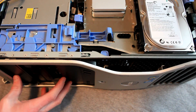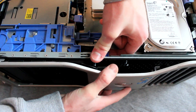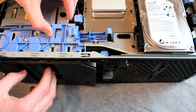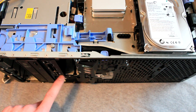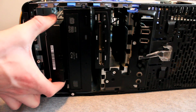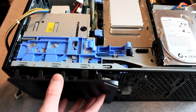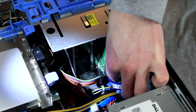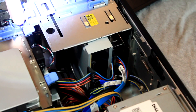We will need to remove the front panel and the drive bay cover to access the bays. To remove the front panel, pull up on the blue tab inside the front of the computer and then push the silver front panel up to remove it. To remove the plastic drive bay cover, push down on the blue plastic latch and pull the cover away from the computer. We now have access to both 5.25 inch drive bays as well as the one 3.5 inch bay at the front of the computer. It is simply a matter of lining the hard drive up with the bay, gently sliding it into the computer and latching the drive into place. Then we will replace the drive bay cover and the front panel on the computer. Now we will make the SATA connection and connect the power at the back of the hard drive. The DVD drive has been slid out of the way to make it easier to see this process, but it is not necessary for you to do so.